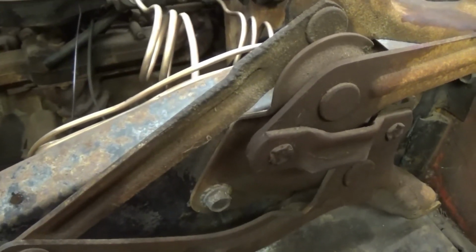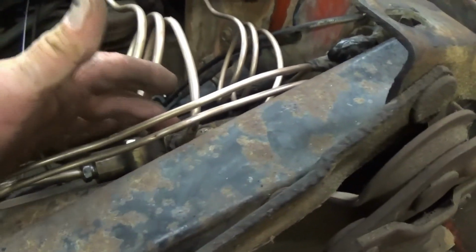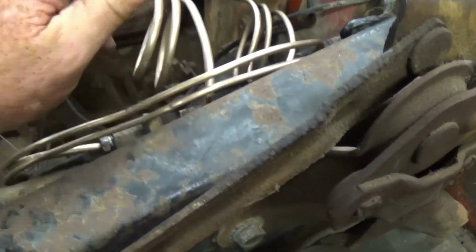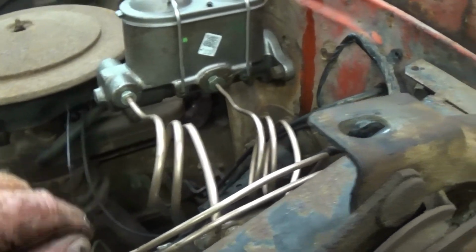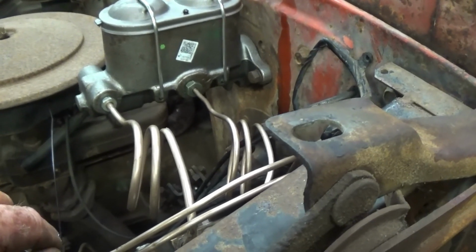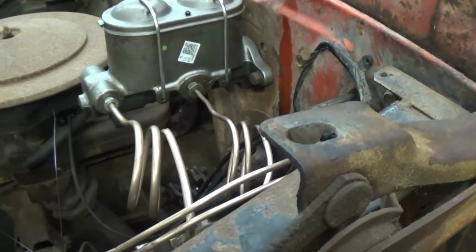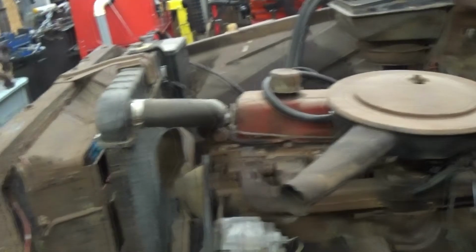light inside the cab. Well, when it does that, there's a little slider valve inside there that's got a little half-moon notch in the center of it where, when it's centered, this little switch has got a little nipple on the bottom. It stays in that half-moon, and when more fluid goes one way or the other, it pushes it over, makes that switch, turns your light on, and it blocks the brake fluid from going to the free-flowing end. Okay, well, with all that being said, I didn't know that.